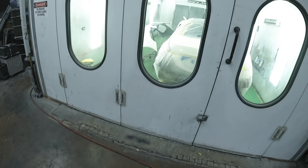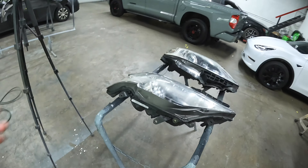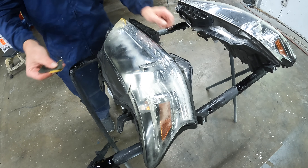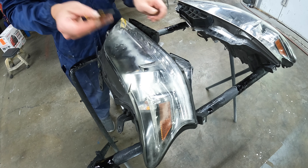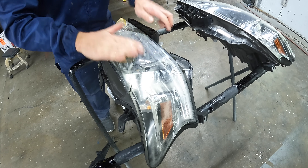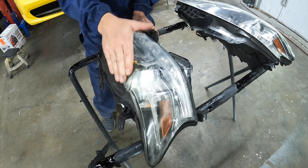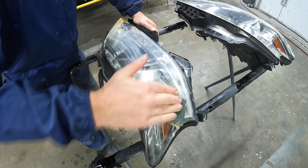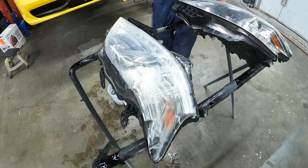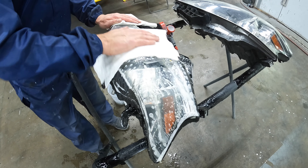I suggest if you're going to do it out of a spray can, get the 2K clear that gets activated with the button on the bottom. I'm going to be using our automotive clear coat since I have a spray booth, but essentially the steps involved are going to be the same. We're going to get 1000 grit sandpaper, make sure it's wet, and just start sanding away at the clear. You're going to have that yellow water left behind — that's all that dirty plastic coming back to life. Then use soap and water or a degreaser and wipe it all away.